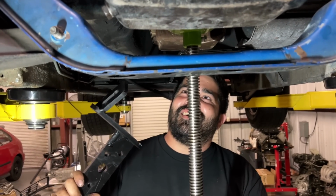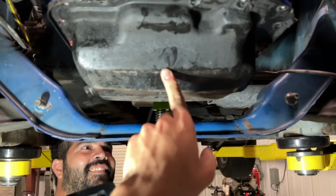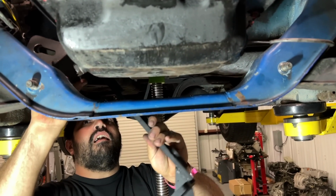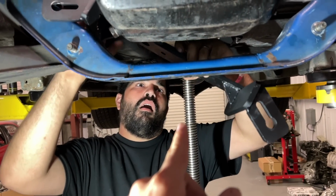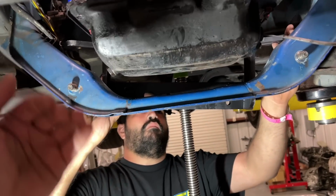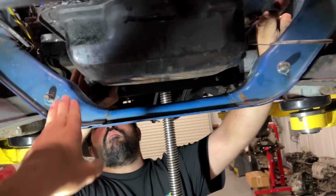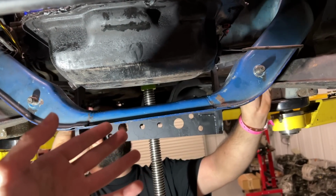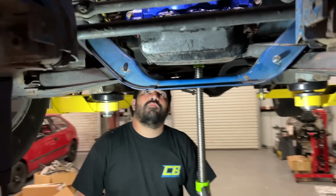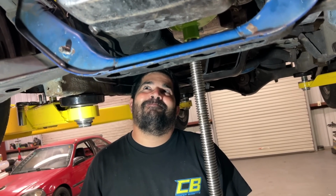I might have to go up a lot. Do we have to go up with the motor some, squeeze her under the pan? You didn't have the oil pan on just a second ago. No, so we just got the oil pan on, so we do have to lift it up a little bit to make some room. But the way this mount works is it bolts to the back of the block here, and then you just have some tabs coming off of it. And the idea of putting the tabs on the front side here is if we ever have to service the SideKick here, pull the engine out, the tabs being on the front side will make it easier just to pull it up and out of the vehicle. But as far as sticking it up under the oil pan, we're gonna have to finesse it in there, it looks like.